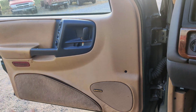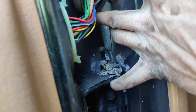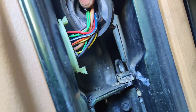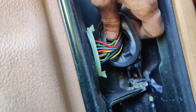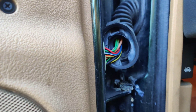I'm gonna lean more towards the broken wire since nothing works, and they probably share a common power or ground going into here. Okay guys, so everything looks good in here. I'm surprised — nothing's broken, all the wires actually look really good. I don't remember having issues before on these older ones. They always had problems with door jamb wires, but everything looks good there. So I'm gonna quick bring up a diagram and see if this stuff shares a common power or ground, then we'll know what to go after.